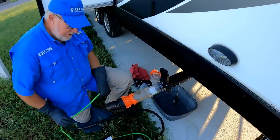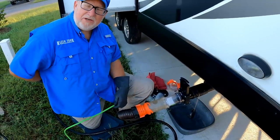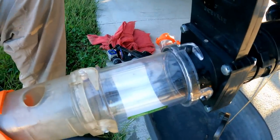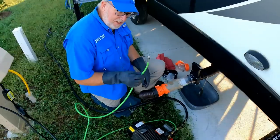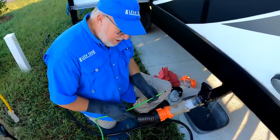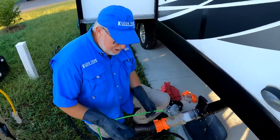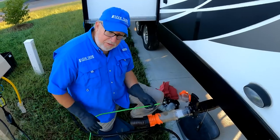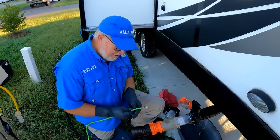Jim wants to make clear he can't guarantee he'll get your sensors to work because there may be some wiring issues, but how often do you think you get them working? About nine out of ten times. Here's his little setup — hooked up to my Valterra valve. This is a cleaning wand attached to our commercial water pump which ramps up to 1500 PSI — some pretty fantastic pressure. A lot of customers ask whether this will damage the tank. It does not. The pressure is pretty intense and this spray head creates a jet about two feet back, but it's not strong enough to punch a hole in the tank. I've been doing this eight years and never had any tank damage.